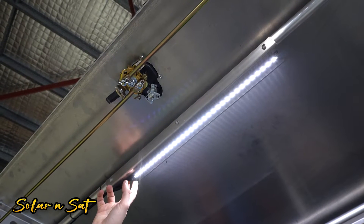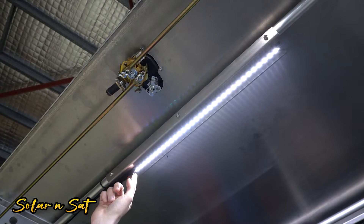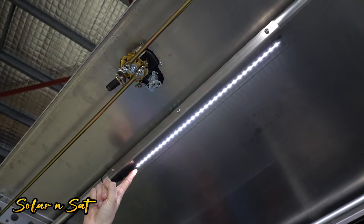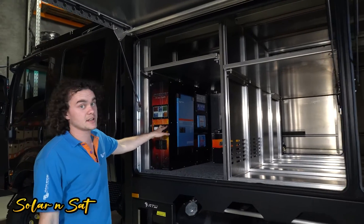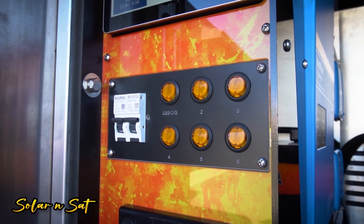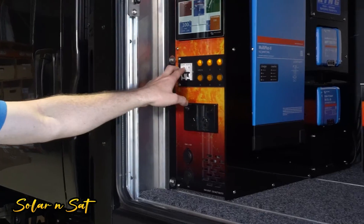These lights are fantastic in the sense that they can switch between white and amber, and they're also our completely dimmable versions. That's a little bit too bright there — they certainly do shine if you want them to — but you can turn them down so it's not quite as harsh. This gives you a nice point to flick them all off at once if you'd like. We've also got three spare switches that can be used for fridges, compressors, anything the customer really wants — giving them freedom to wire some stuff up.